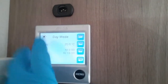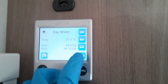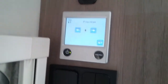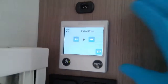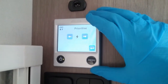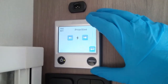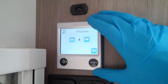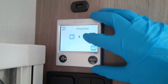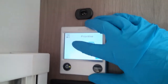Next we have a picture of the sun — virtually the same again but for day mode. Prioritise is what the system prioritises when in dual fuel mode. At the moment it favours mains electricity over gas, so it will use both power sources, get you up to temperature and then cut the gas off and maintain on electricity. If you are on a very low amp site you can flip it so it consumes more gas and less electric.